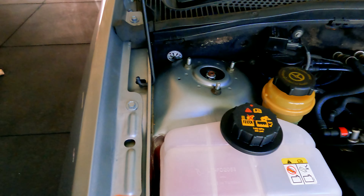All your coolant is back in and all your hoses are tightened up. You shouldn't really need to bleed this system because you haven't really emptied the coolant system — you really just emptied this bottle, so no air should have gotten in past this line. As you can see, the coolant's back in at the same mark it was before we took anything out.